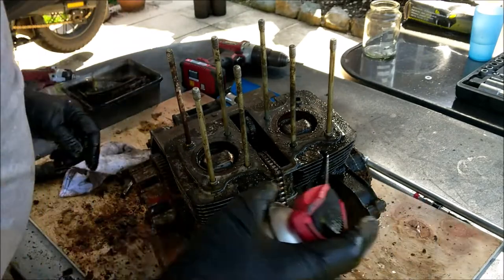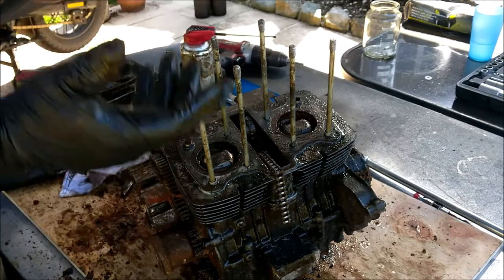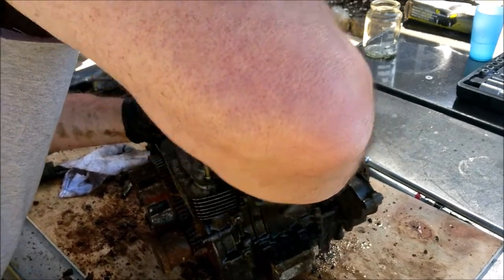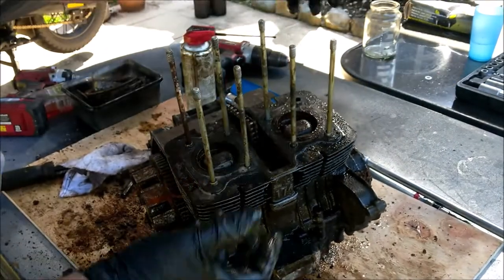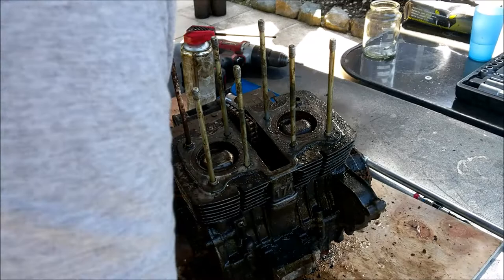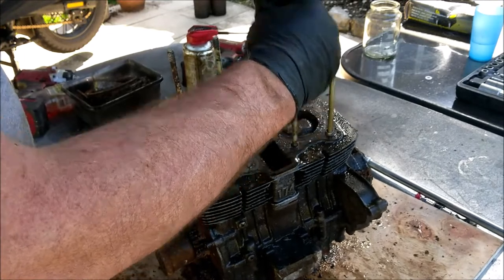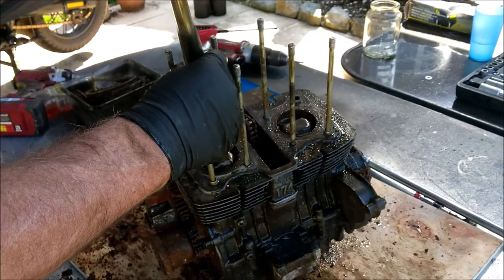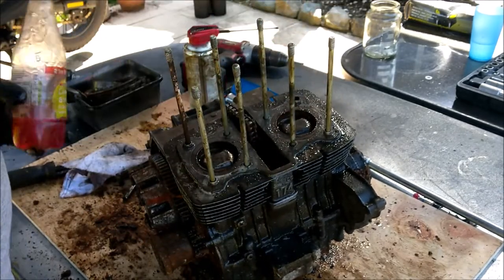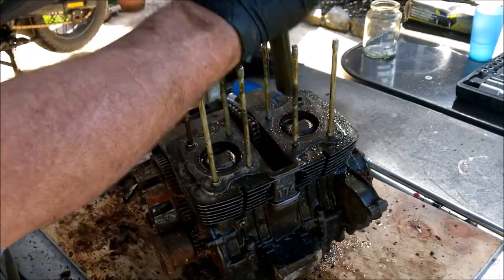The thing is, on a normal day, with the pistons being nice and slidey and not seized, this would just lift off of there easily, but where the pistons are seized and everything else is seized, the pistons are seized in the bores, of course the crankshaft is seized, so you're trying to pull up everything whilst achieving nothing. I've given these pistons a bit of a tap just to break any seals there. I've got a little bottle of diesel. I had some diesel in the bores, what's left of them, whilst I went and had a spot of lunch. Nice prawn sandwich, oh yeah, that was good.